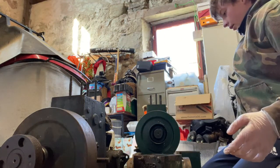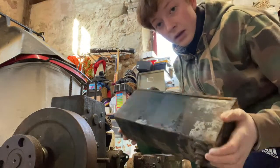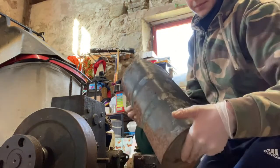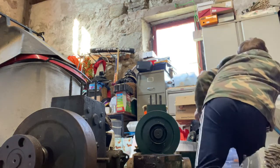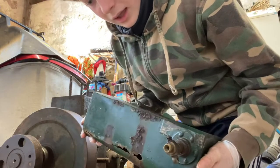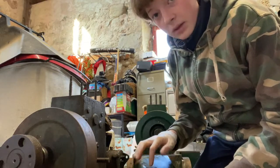These are the fuel tanks from both engines. This one from the newer engine doesn't look too bad — there's quite a lot of surface rust on top but the inside still looks good. The other one has a big hole in the bottom and you can hear all the rust rattling around inside it, so I'll probably take the fuel valve off that one and use it in the good tank.